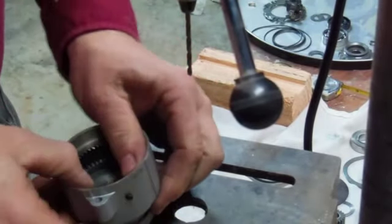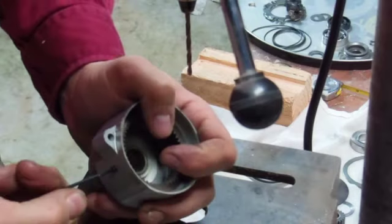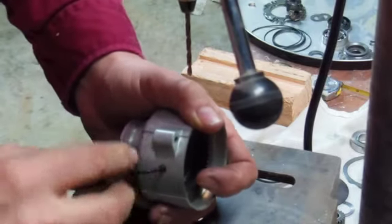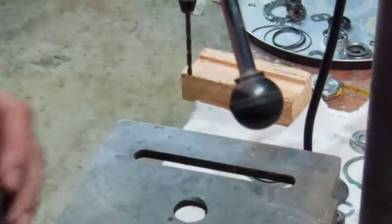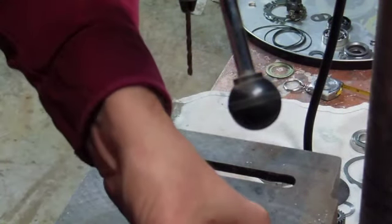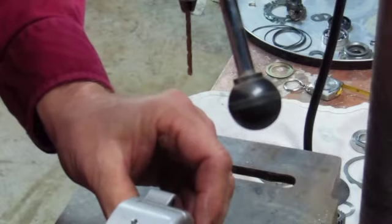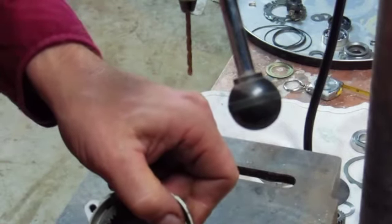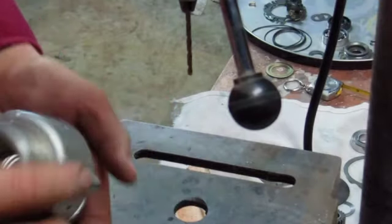Look how tight that is already, because it wasn't cleaned out inside. It's gonna tighten up real nice. Get a little thread lock in there, or thread ease, or whatever. We'll be off to the races. I drilled these holes out, tapped them, put the ring gear in here, and turned it until — it's a little low because not all of the components are in there — but I've lined it up and I can see all of my marks. I've put a Sharpie mark here and a Sharpie mark there, so I know the way it's gonna go back together.